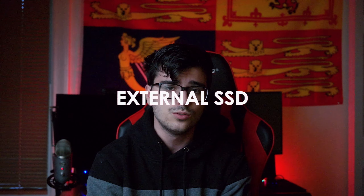The Ninja V writes to an external SSD, so I'm not wasting the memory cards in my Z6. I can use those cards for photos or quick casual videos, while the SSD holds my higher-quality master files — my ProRes and 10-bit footage. What you'll need is a SATA-to-USB-C or USB-A cable, depending on your computer. I use USB-C for quicker data rates. The cable is about $15 on Amazon, and it lets you transfer all your files to your computer so you can view, edit, and export them.